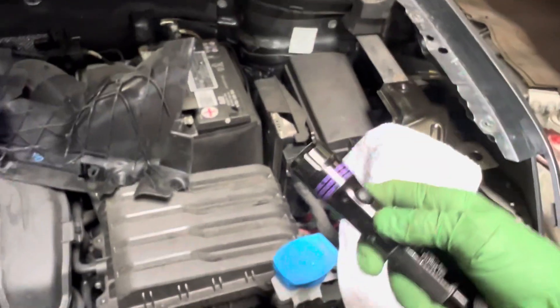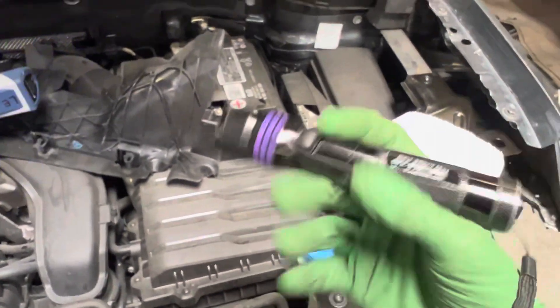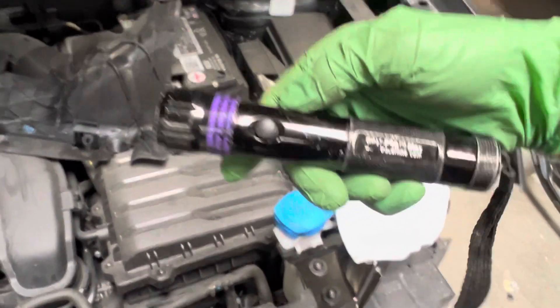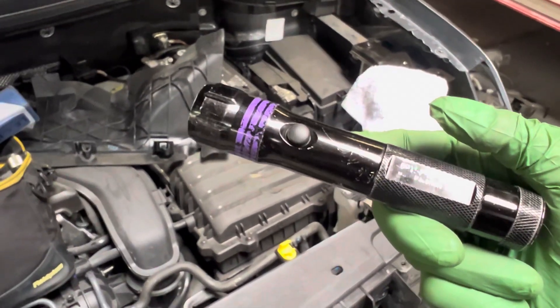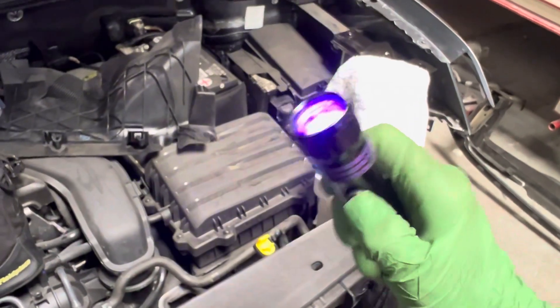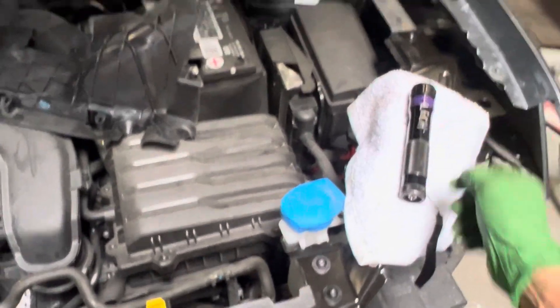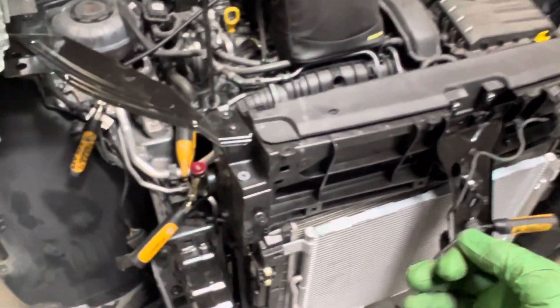For a little small handheld, get the best. That OptiPro Max — this is from Tracer line. For little flashlights, Conroy makes a really powerful smaller flashlight, but they actually make a more powerful model now. It was about $250 when I was at the MACS Mobile Air Conditioning Society convention — I stopped by the Tracer guys and they had a really good powerful one for $250. But the UV Beast is only $59 to $70, depending on which one you want to get.